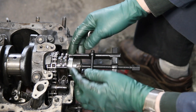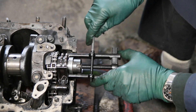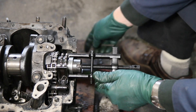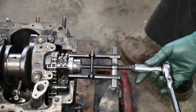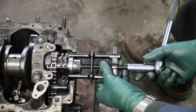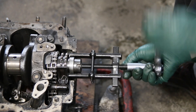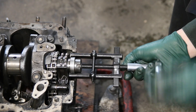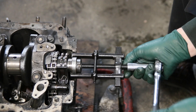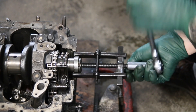I've adjusted the puller and positioned it behind the race. I'm going to snug these two hex bolts down to make sure I'm thoroughly clamped onto that race — you don't have to tighten these too much. Let's see if that'll do it. Here it comes. Granted, not as fast as the factory tool, but in most cases this can get the job done. I can't guarantee it'll work for every single situation.